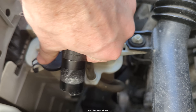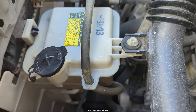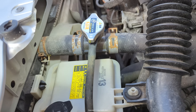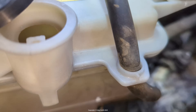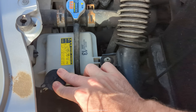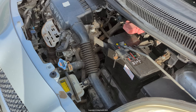I'm just going to pop the overflow tank cap off — remember, it is safe to take this off as long as the whole thing's not trying to overflow. It's not safe to take the radiator cap off when it's hot, but this one's not under pressure, so it's okay. If I shine a light in there, the level's gone up a little bit and it is very, very slightly pink, which means there's a bit of mixing happening already. That will just continue. Okay, that's enough for this video — I hope that was helpful!